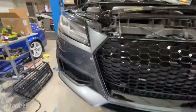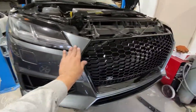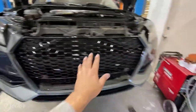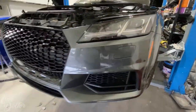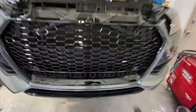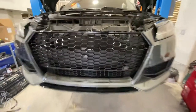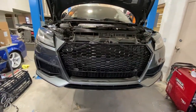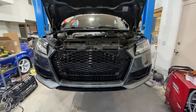Bumper's on with the new grille. We got everything to line up exactly how it should — that fender-to-bumper gap is perfect, everything underneath the lights is lining up perfectly. The grille is looking amazing, and with that crash bar painted flat black underneath, you can't even tell there was a silver crash bar there. Now we'll go ahead and put in all the bolts and we should be done.